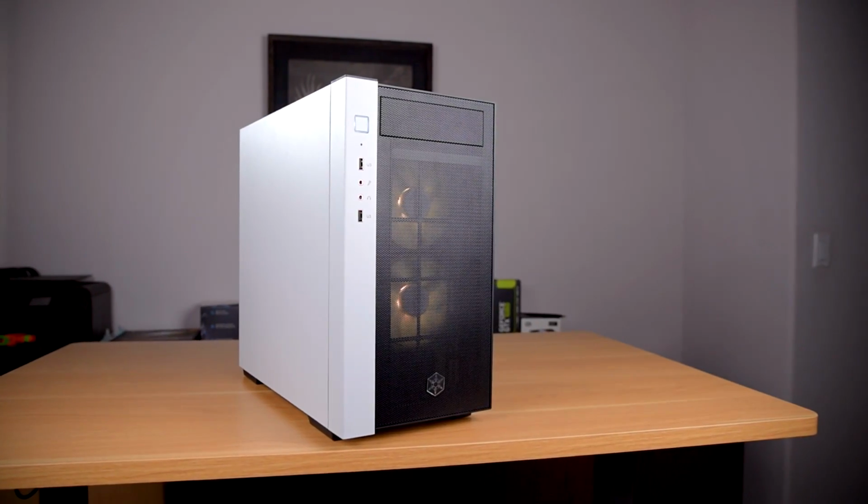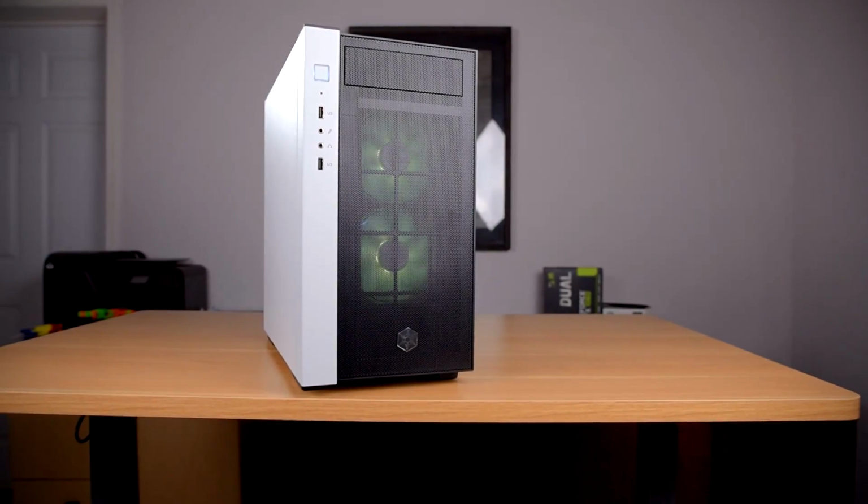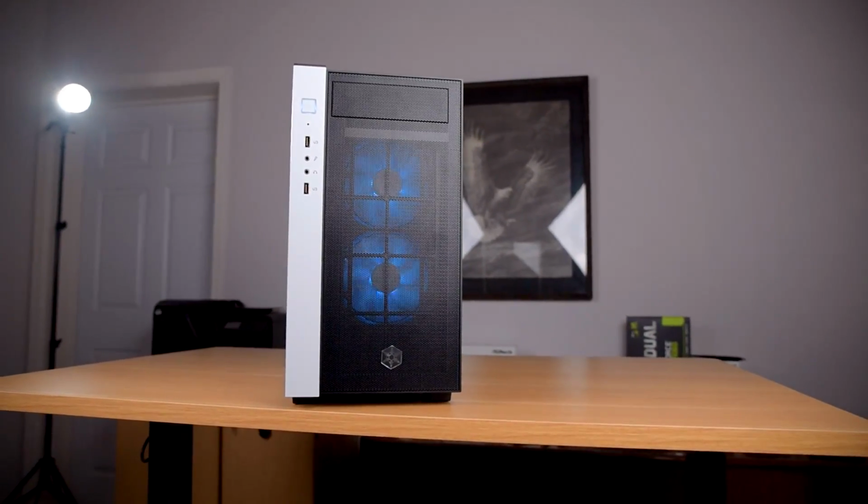What I found in most cases, pun intended, is it's worth it to test fit the motherboard and see which headers or power supply cables will be hard to reach once the motherboard is installed. Plug those ones in first before putting it in the case, and you'll save yourself a huge amount of hassle in the build process. This is also where a modular power supply has a distinct advantage over non-modular, since you can much more easily route the power supply end of the cable through whatever cable management holes you'll be using.